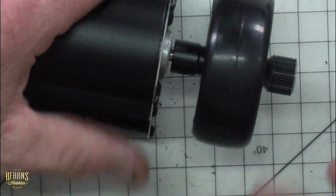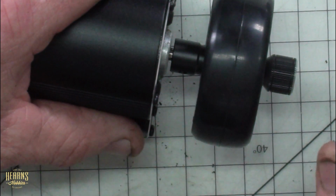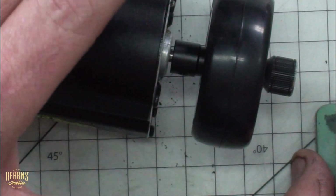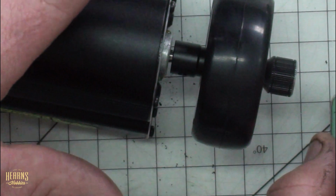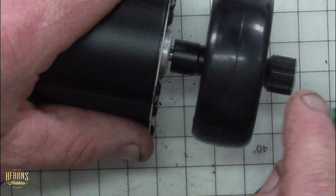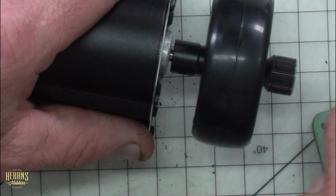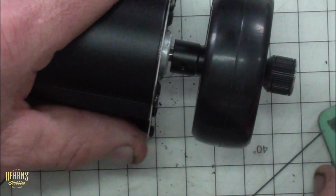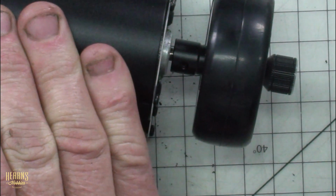It absorbs the additive better, and if you just put a brand new tyre on the track like that, it's quite good, quite grippy, but it's also loose. The car can be a little bit loose, but if you clean it and scuff it up, clean that up, then goop it, the traction will be epic. It'll be fully sick, bro.